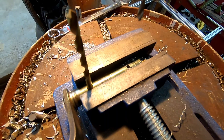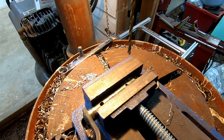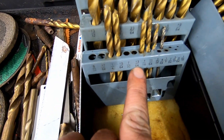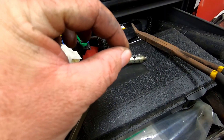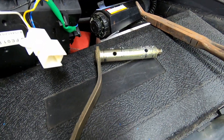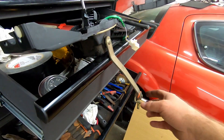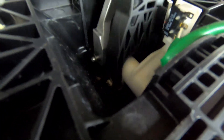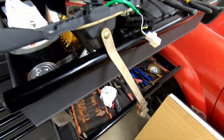Let's drill it. We have a clean pilot hole — switching out the drill bits to the bigger one, let's finish it off. The size hole that worked perfectly was 13/64ths — that is what made it go in really, really well, with just maybe 1 or 2 thousandths of wiggle room. You have to tap it in, which is much better to get the C-clip on. Here it is on the flipped side. We have the retaining clip back on, everything is back to functional — just the arm is flipped all the way around. Let's put it back together.